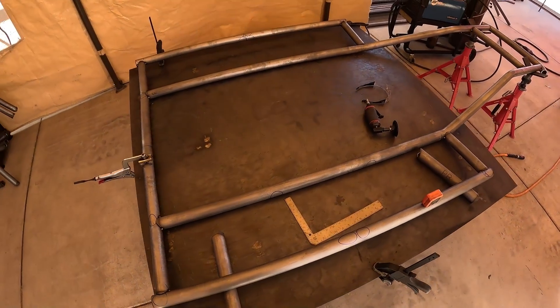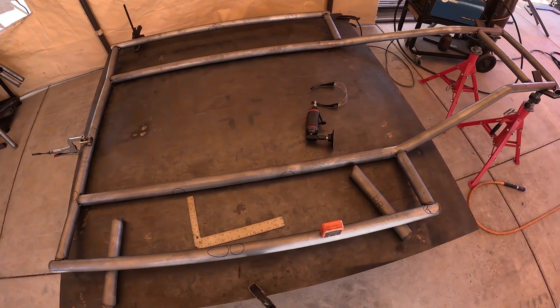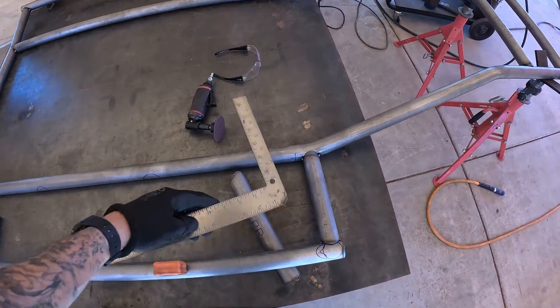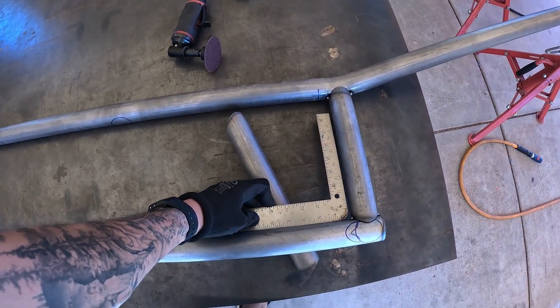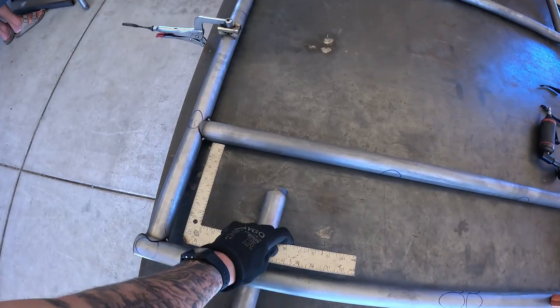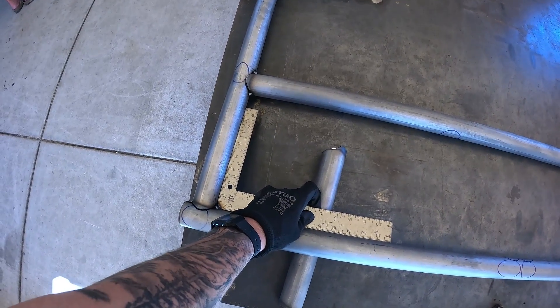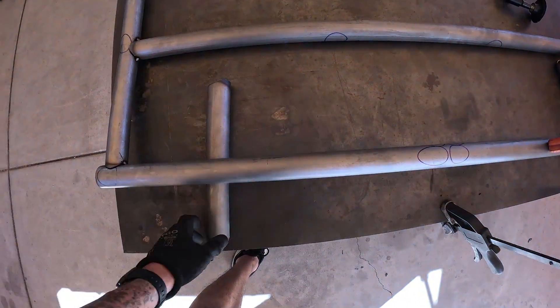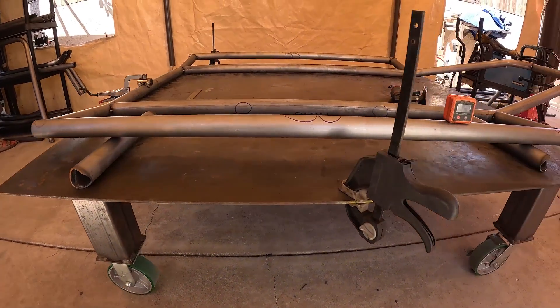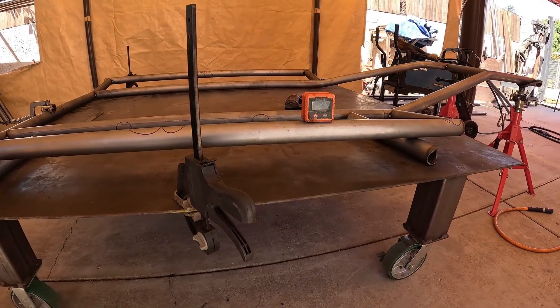The slider tube is exactly an inch and three-quarter above where the main frame rail sits. Just get some extra inch-and-three-quarter tubes, put them under the slider tube, get the cab rear square to the slider tube, then put the cab front tube in place and tack that together. That'll have the height set — then make sure it's level and tack it in place.